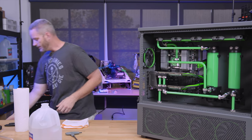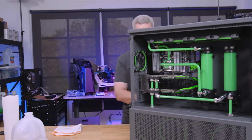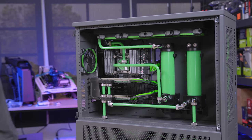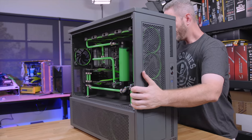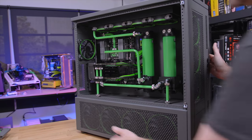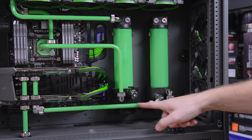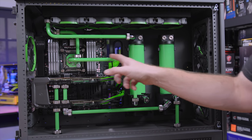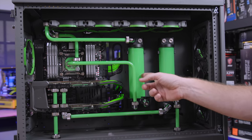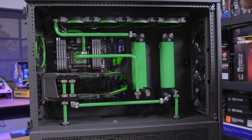This is going to be pretty easy today because when I set this up, I've got easy drain ports, fill ports. I've got two loops in this — I'm going to save the GPU loop for last because it's kind of a pain to get all the fluid out of. But the CPU loop is all contained right here: it goes into the reservoir, out through the pump, into the CPU block, through the rad, and back into the reservoir. The drain is at the lowest point, so this is extremely easy.